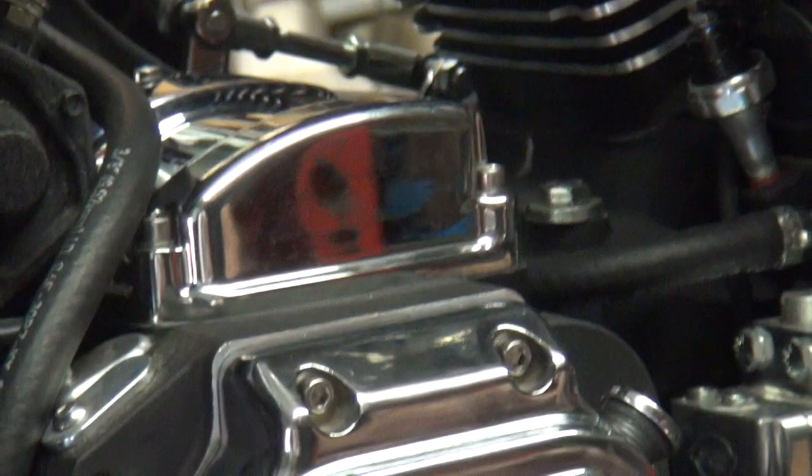Okay, now that rotates. Now you notice you only got half the bolts holding stuff together, so don't look at that. Okay, we can go ahead and leave that in the air when we run it. That way it's free to spin if it wants to. Get some oil inside the tranny. What are we gonna use on the tranny? We're gonna use Sportster transmission lube because we like light duty oil that's easy on turning for high speed work.